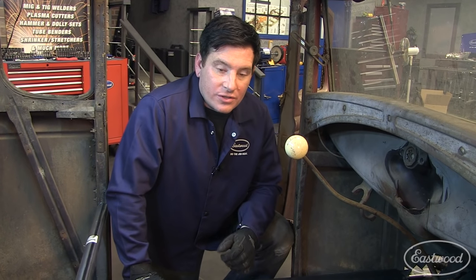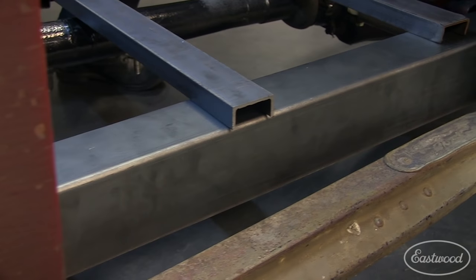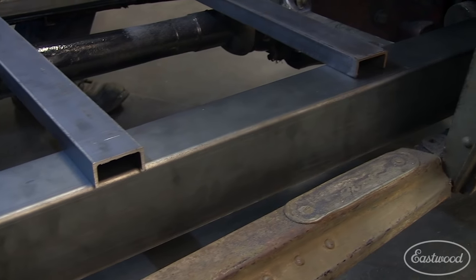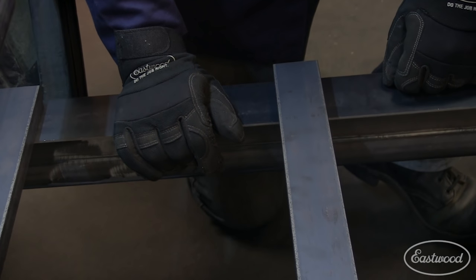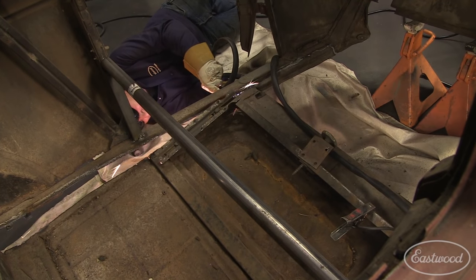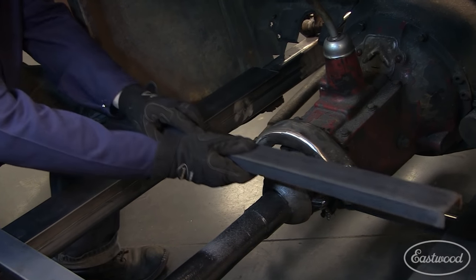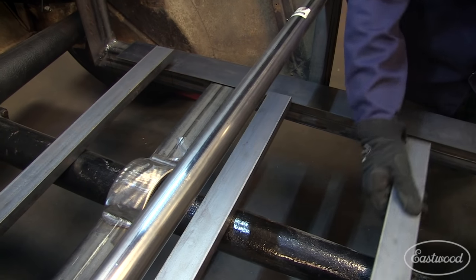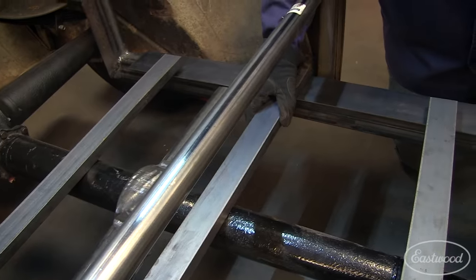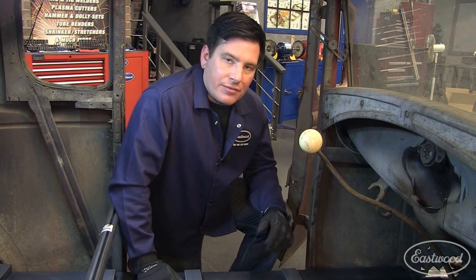Now that we have the body sitting down over the chassis at a height that we like, we're ready to start on the subfloor. The first thing I had done was have two pieces of eighth-inch steel bent up to 90 degrees that run basically the length of the cabin of the car. These pieces are going to sit over the chassis and be modified slightly so that they sit against the rocker right where we cut out the floor originally. After that, we have pieces of U-channel also made out of eighth-inch steel that will run across the width of the chassis connecting everything together. After a few modifications, we can weld all these pieces together, drill some holes, and set everything up so the body will bolt on just like factory.